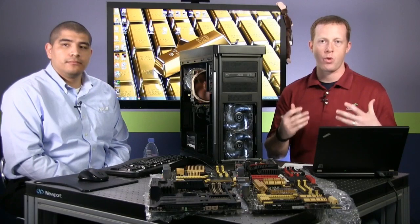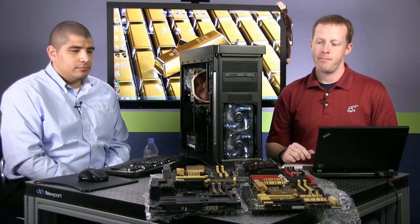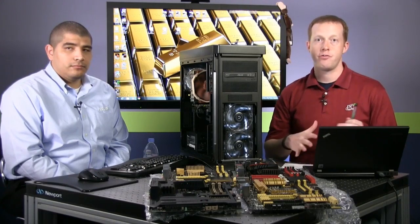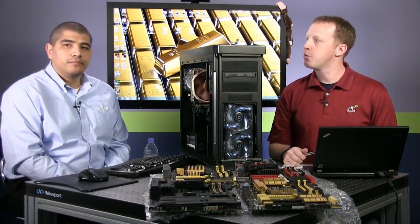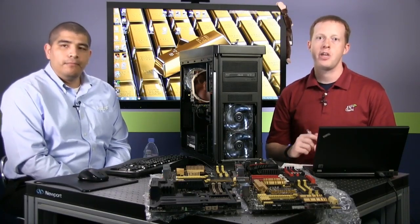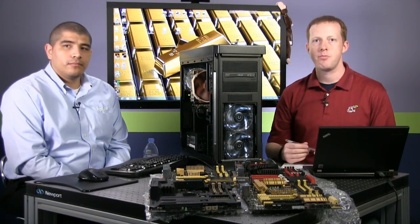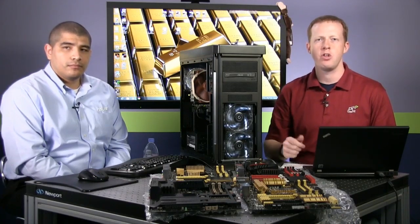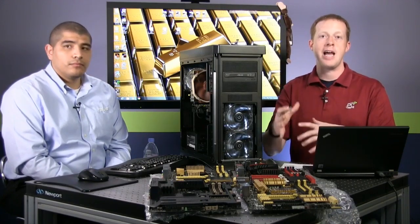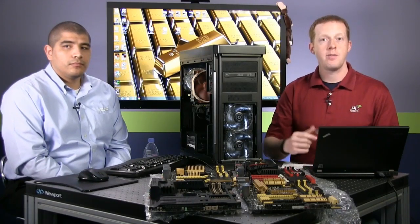The last thing I'll say on just the processor in general is go to pcper.com, read my review of that. From a desktop user's perspective, we're seeing anywhere from 5% to 15% performance improvements on CPU-bound applications, depending on things like media transcoding, instruction sets and things like that. If you get into AVX2 capable software, which there isn't really much out there yet, but SiSoft will run some AVX2. If you look at the SiSoft Sandra multimedia test, for example, it uses AVX2, and you can see a huge jump with Haswell over Ivy Bridge and Sandy Bridge E and all that kind of stuff. But it's something that's coming down the road.